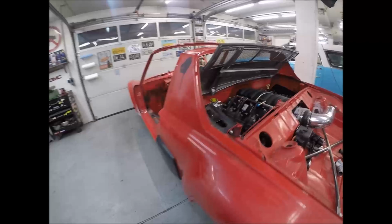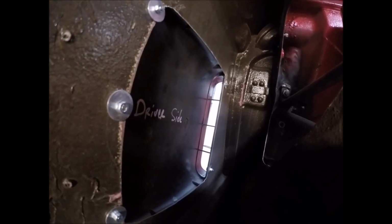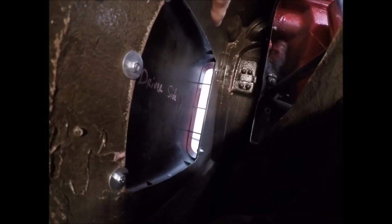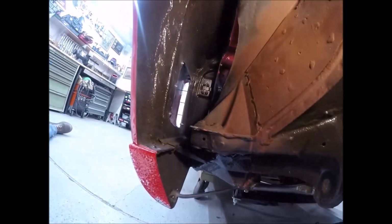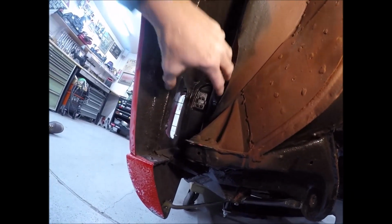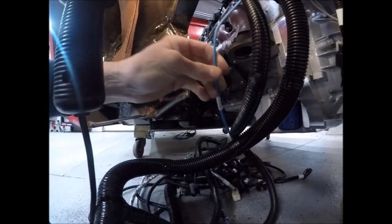But anyway, what I wanted to show you here is a couple of things down here. Let me get my little old 56-year-old body down here. This is where the radiators are actually going to sit up in here. So you can see I've got my cheap eBay ducts on the side. These are actually supposed to be hood scoops for decoration, but I went ahead and got myself these little bitty bolts, tapped them into the back side, and on the front I've got two, looks like M10 bolts up in there, of course on both sides. Now those two Mishimoto radiators fit on this side, along with a spal fan on this side, and then that big green, big blue cable right here that says fan, and then the ECU takes care of all that.